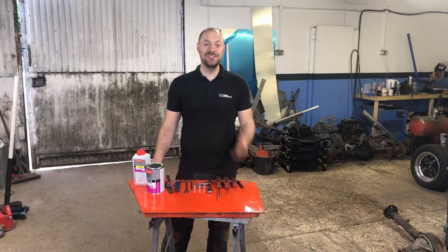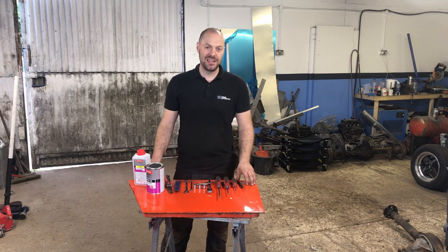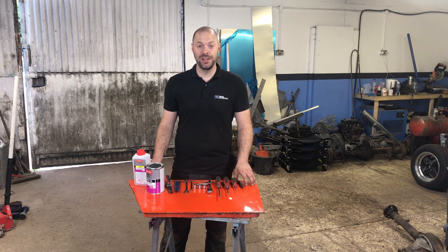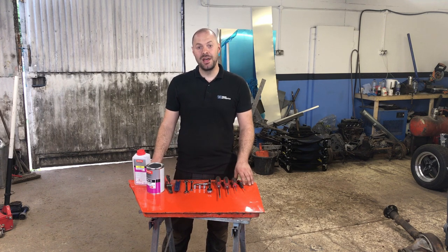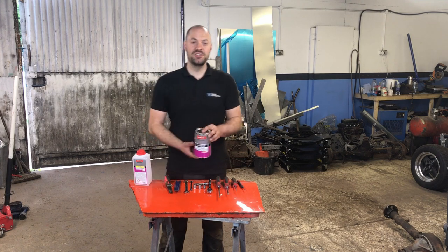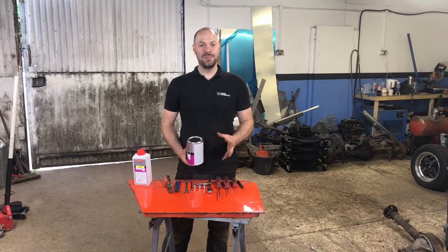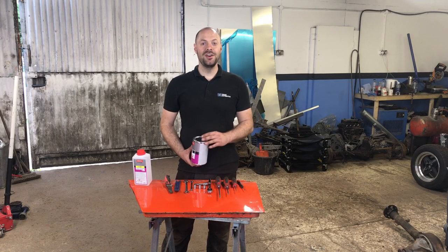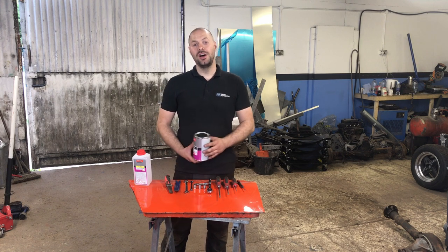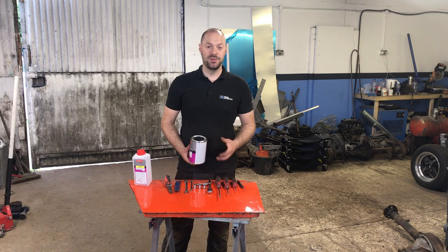I'm sure, like me, you're hoping to see some media blasting next. Unfortunately, there's been a change of plans and we've had to reschedule to tomorrow morning. That has, however, given me time to visit my local paint shop and pick up some Novol Protect 340 wash primer. This two-part primer and hardener will protect the bare metal straight after blasting. It's applied in a light even coat all over the car and will protect it from any flash rust and also prolonged rust before it's in final paint.